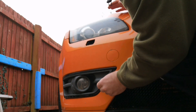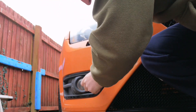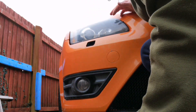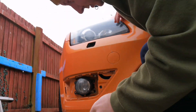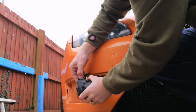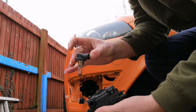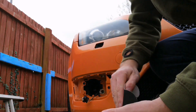So in there you've got your Torx bit, and there's a little Torx bolt in there — take that out first and put it down somewhere safe so you don't lose it. Take the surround out, and then you've got two more bolts inside — well, usually you do, I've only got one — same T25. Then obviously there's a push connector; put a tab there and push that down. So we've got that all out, and now we've got the bulb to take out — these just literally twist out like that. It's a H11 standard, so let's open this up, get one out, and install it.